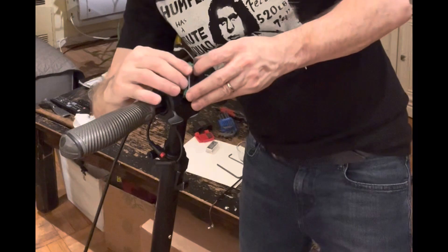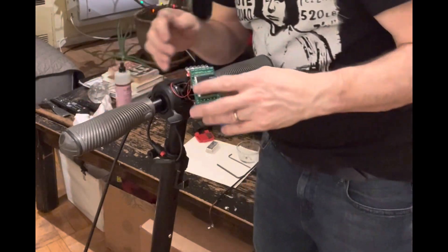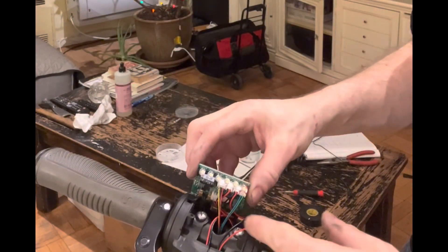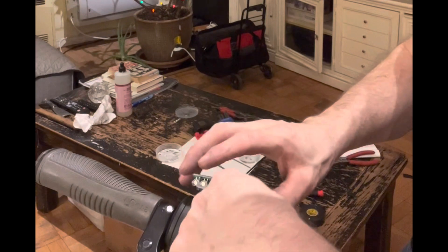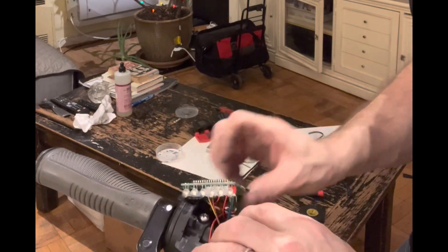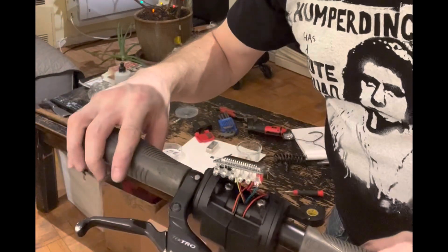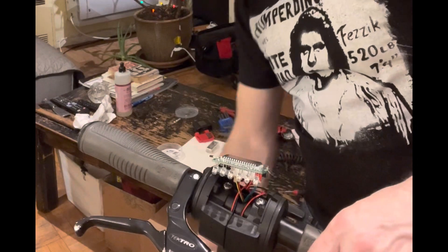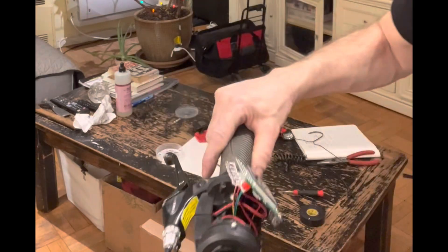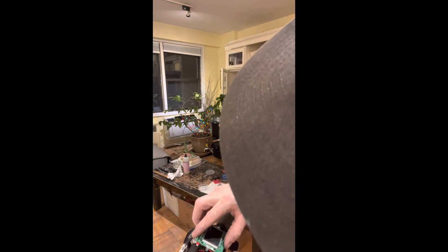You can push them in there with your finger — you'll feel them. Just push them with your fingernails and make sure they're seated all the way. All the wires are hooked in place. There's room in here to let them wiggle around and get into position. When putting the LCD screen back in place, make sure that none of the wires are covering the holes where you're going to put the screws in. There are two light-emitting diodes on the side that have to line up with the two notches on the side.